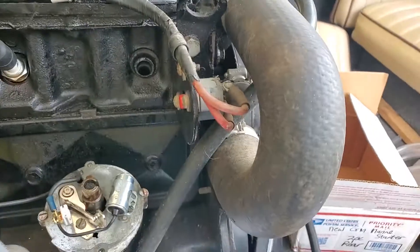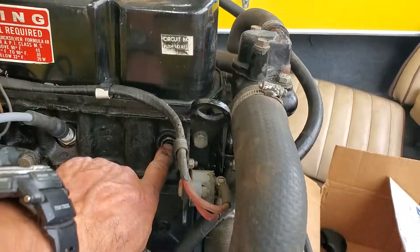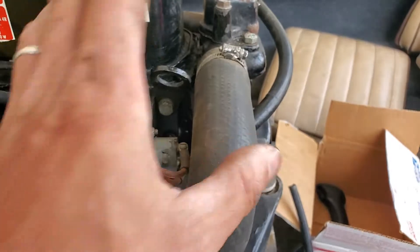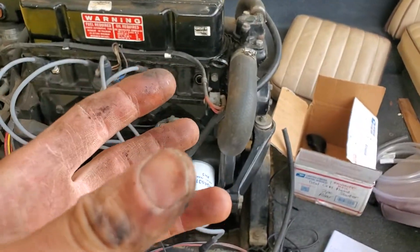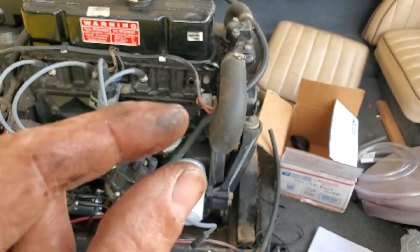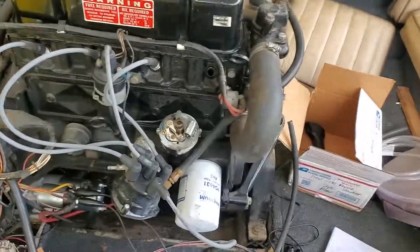So basically we know now that the engine is pretty much on the compression stroke, which means it's just blown past my finger. When that mark advanced up to the stop a few seconds ago, you can keep going in circles until you're sure you have it on the compression stroke and it stopped a little before the mark. Even if you got it on zero, the motor would still run enough for you to put a timing light on it.